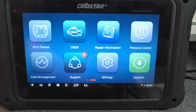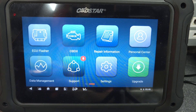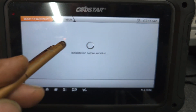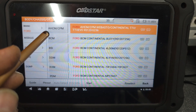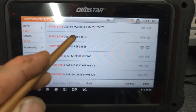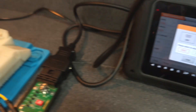I'll put my camera right here. From here, I go to Flash, then to Body Control, then enter. From there, we go to brand Ford, then to BCM. My BCM is Delphi, and that's the CPU number. So I'm going to use the bench and the adapter P004.